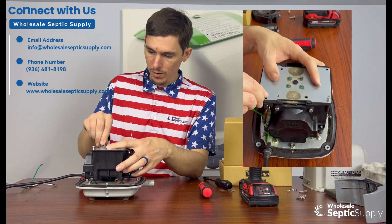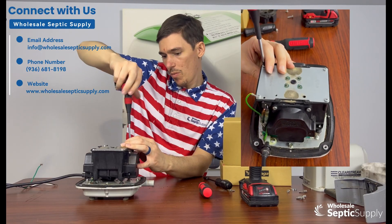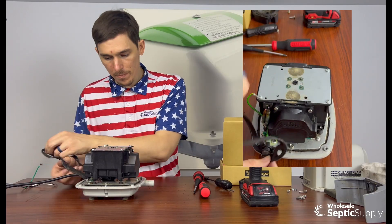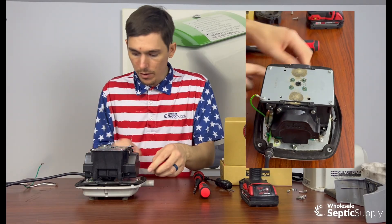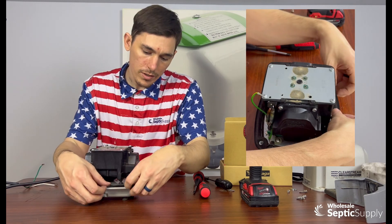Get our grounding wire — want to make sure that's connected. Then we can get the outer gasket for the motor housing. Let's get this old one off — just lift it up and it comes off just like that. Let's get the new gasket for the pump. There are pins around the sides and back, and you just get it setting in there nice and tight.